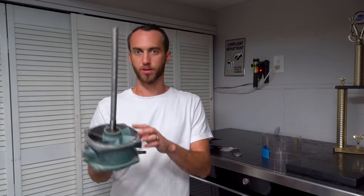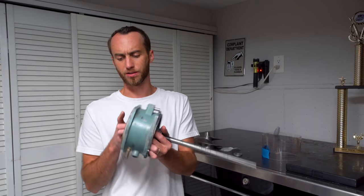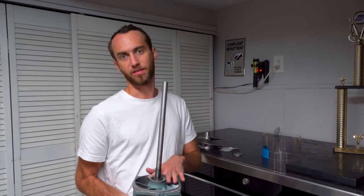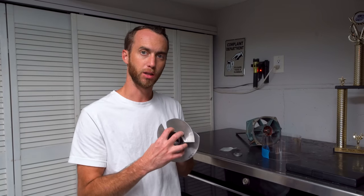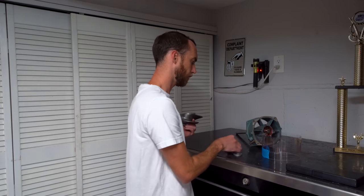There's a stock size pump — this is a stock 155 millimeter Yamaha pump, very small, hubs are maybe 70 millimeters. Your standard big hub mag pump would be 75, and the extra large hub mag pumps are 83. A smaller hub size will allow you to run a lower pitched impeller because you're moving more water, and as you get a bigger hub you actually have to go a little higher in impeller pitch generally, because you're moving more water faster to get the same volume of water going through.